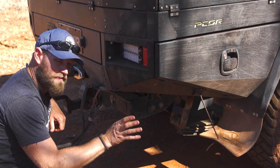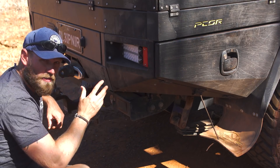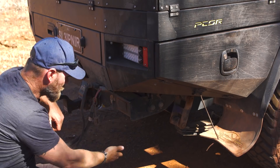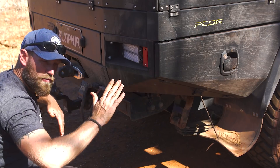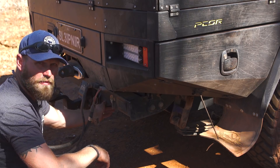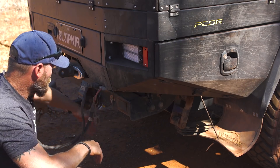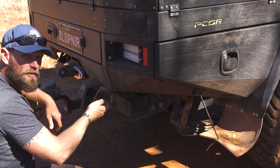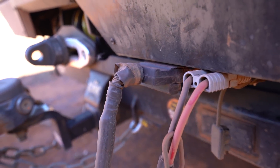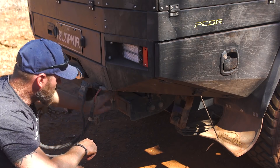One of my favorite subjects when it comes to towing: vehicles not designed for off-road use have trailer plugs and Anderson plugs installed underneath the towbar assembly — that is the worst spot. If you're on technical departure-angle terrain like a washout or a gully, they will get collected and caught up in rocks and sticks, which is how things break and lines get torn. If you have yours underneath — which you more than likely do — relocate them on top, and they'll be out of harm's way. These on the tray are underneath the tray but they'll never contact the ground before the towbar does. Put them on top, not underneath.